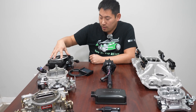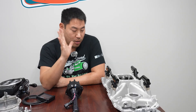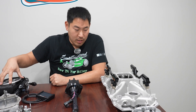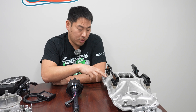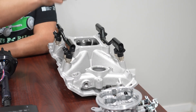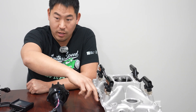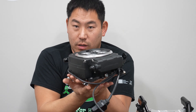Now we have multi-port fuel injection. This is actually for a small block Chevrolet, but most newer cars, all the LSs, come with multi-port injection, and some of the newest engines have direct port injection. The great thing about this versus a throttle body is that you have better fuel atomization because you have one injector per cylinder in each bank. Each injector is shooting fuel directly into the cylinder head, essentially, where the throttle body just lets air in and the fuel injectors do their job from there.